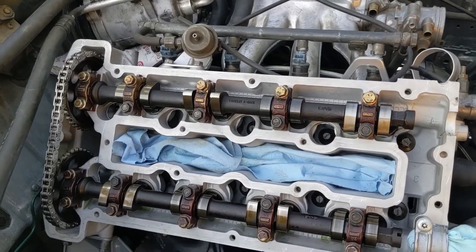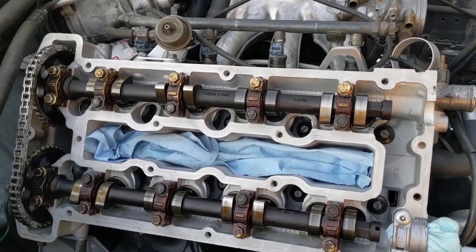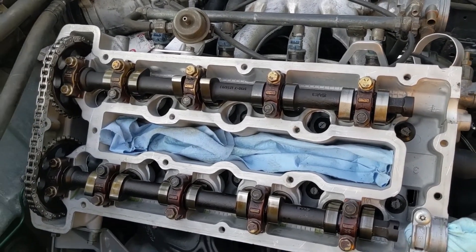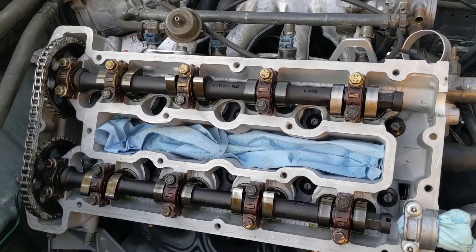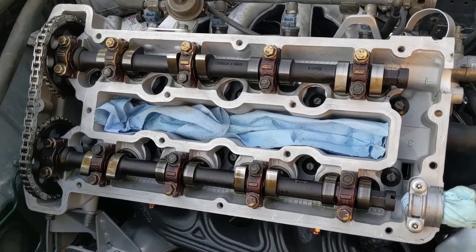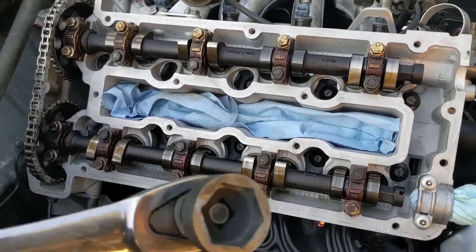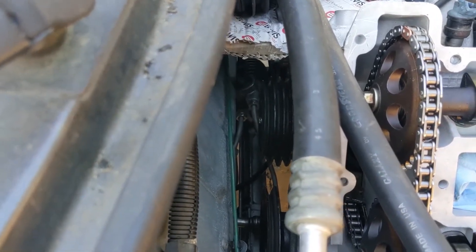The final thing - and you're foolish if you don't do this - is after setting the cam timing and getting the tensioner finger tight, the last thing you need to do is crank the engine over by hand several times. You want to do that to be sure the timing stays lined up after the tensioner has had a chance to actually do its job. On this car it's a little painful. What I've got here is a 30mm socket that's had most of it cut away - very shallow inside - which is necessary to clear the space between the firewall and the crank pulley. It's pretty tight down there.